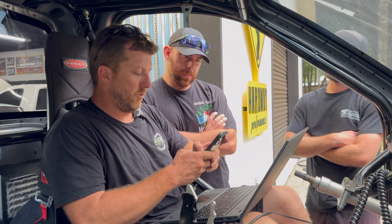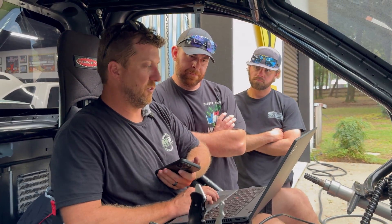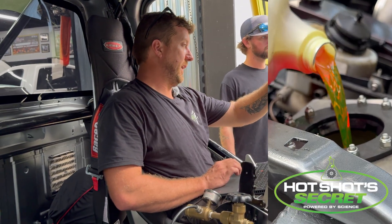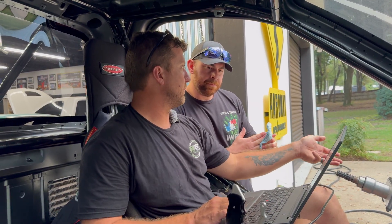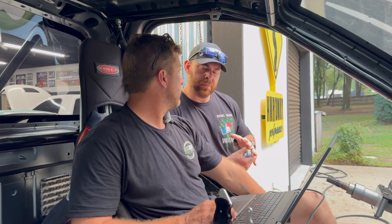The idea is we want to give it the amount of fuel mass so it'll go to 13.5 AFR if it has to, but we're going to lean it out with nitrous. That's all nitrous is — a lean-out tool. There's pilot one and pilot two; pilot two is the one closest to the main. You can run two pilot, main, and two post if you want. I run pilot until the engine tells me it doesn't want to. I go up in engine speed and turn pilot off and on — if it uses less fuel mass it means it wants it; if it doesn't change, there's a point where it just doesn't care. Typically big injectors with a lot of body mod don't care.